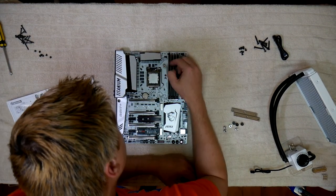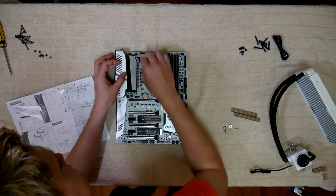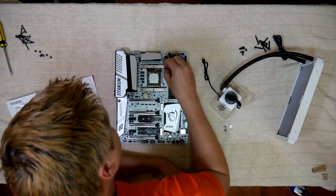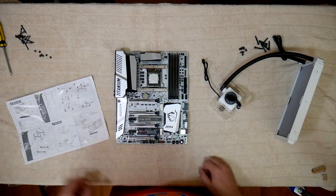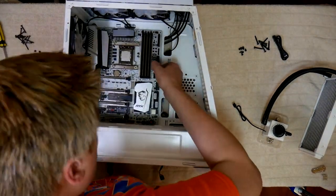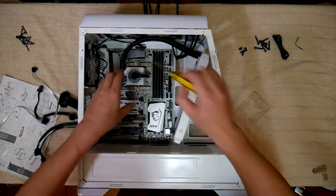Next I install the spacing nuts on top of each screw — this creates a post for the mounting bridges to rest on. Now I'm putting on the mounting bridges; be careful that they don't rest on any components on the board. You don't want to fry anything. The fastening nuts go on top of the bridges. Time to put the board inside. Overall I found the install to go smoothly and it wasn't hard — just took a little thought. I likely would have had an easier time in a larger case, and a super easy install in a case with a full CPU backplate cutout.